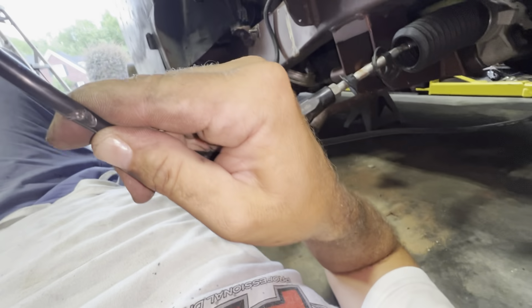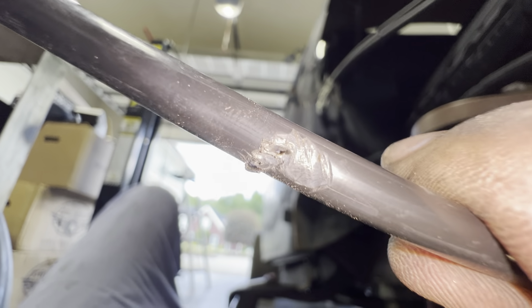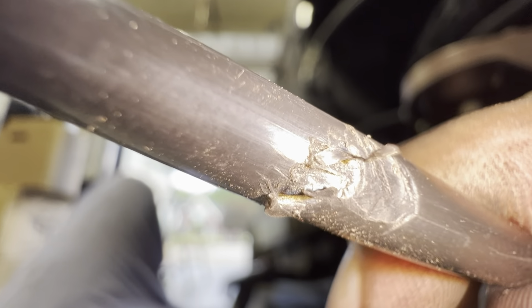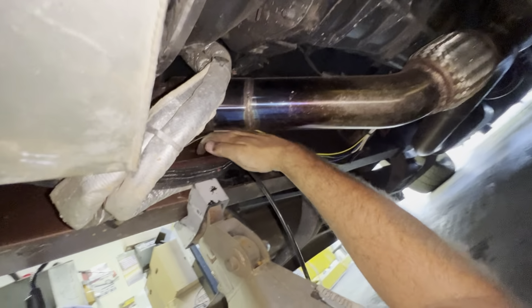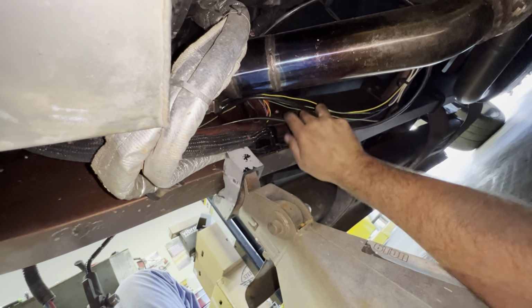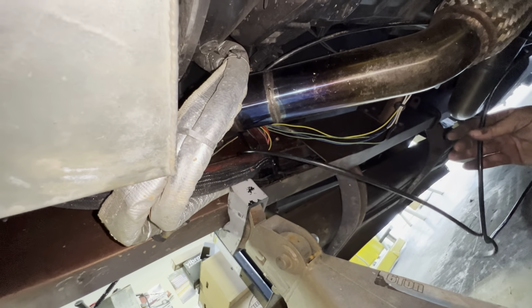So I've had this air leak that I've been fighting, ever so slowly. And I'm wondering if that left front is where it's leaking. Maybe we'll give it a try. I thought maybe it was the airbag. With the suspension work that I did a little while ago, I actually swapped the bags from one side to the other, hoping that was gonna fix it. And the problem didn't move. So that told me it was either something in the line like that, or maybe a solenoid. But yeah, so hopefully that's it.